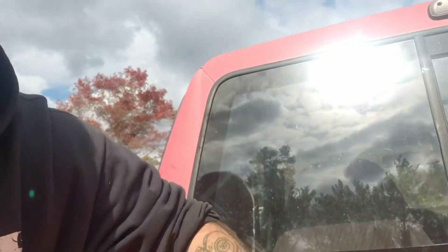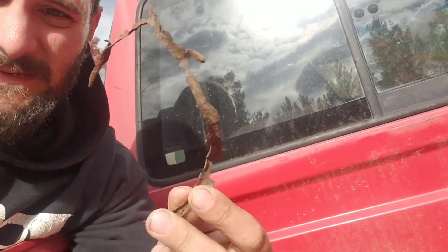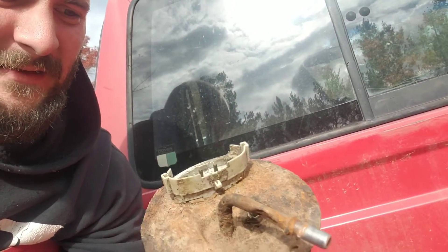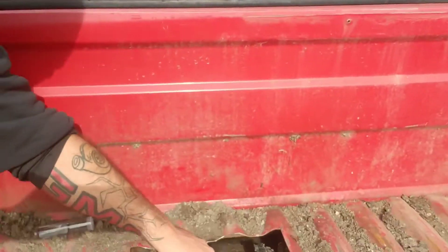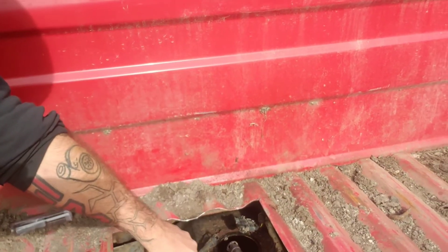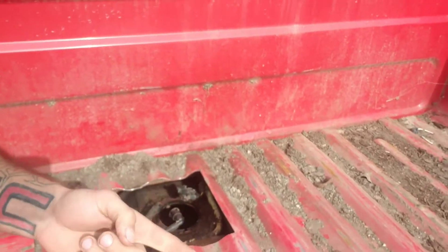The snap ring — or not snap ring — but this thing, and this ring on here is a little beat up so I'm hoping it'll lock. If it doesn't, this is plastic — I'll just drill a couple pilot holes in the fuel pump and use a couple little self-tappers. Shouldn't be too bad. I'll put the liner back in there once I'm done.